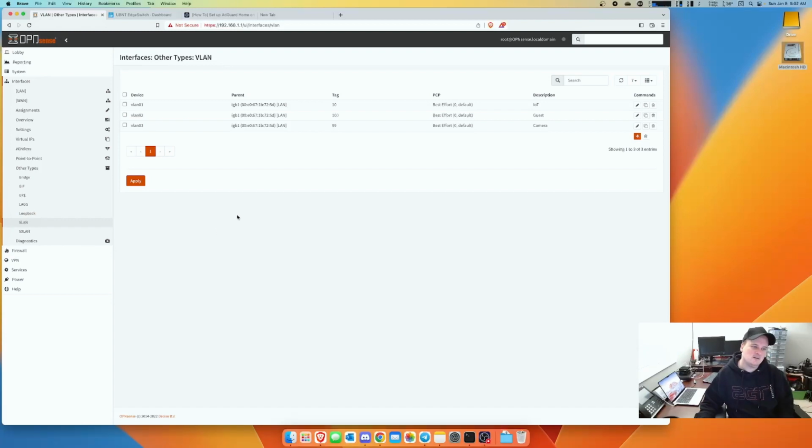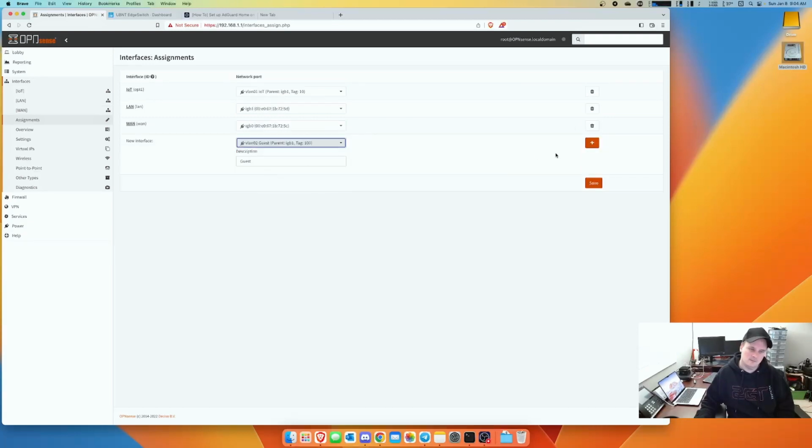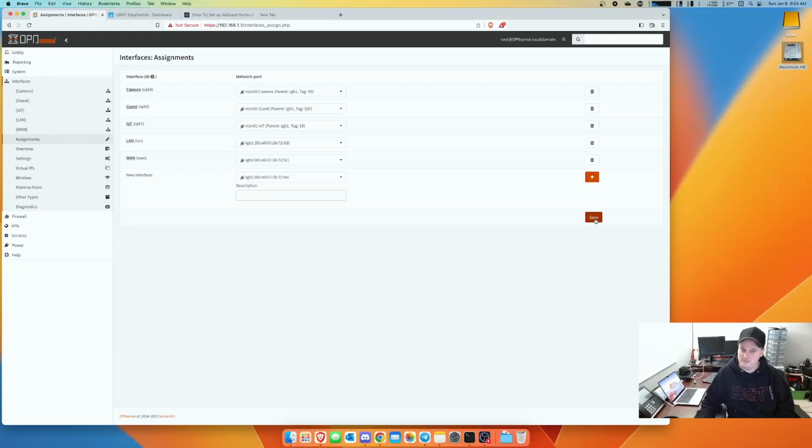As we're in here, we now have to define them. Assignments. So we should be able to go here, add, next one, add, save. Wait a couple seconds. Now we should give them their IP addresses. So now we can see over here we have all our camera, guest, and IoT.